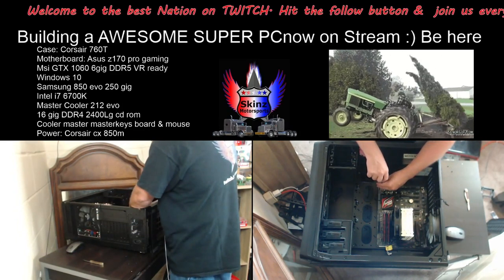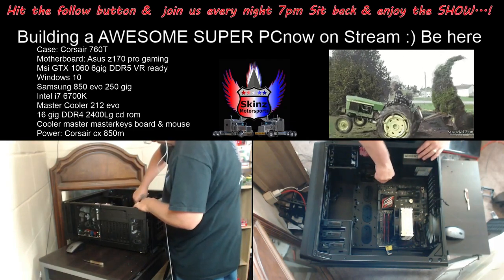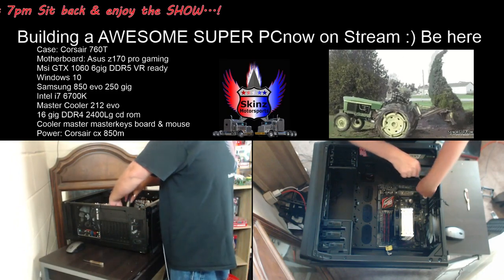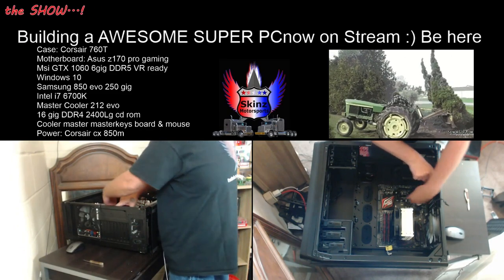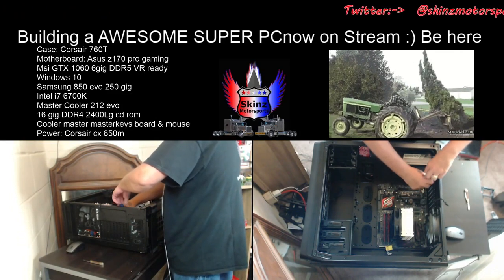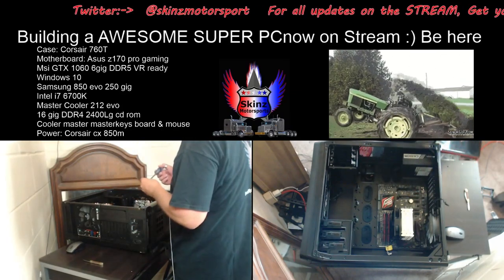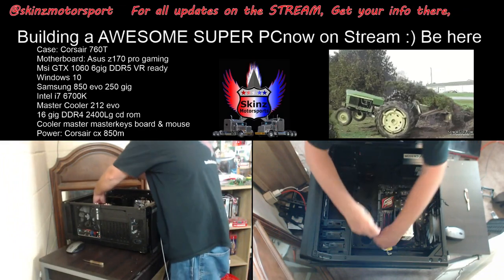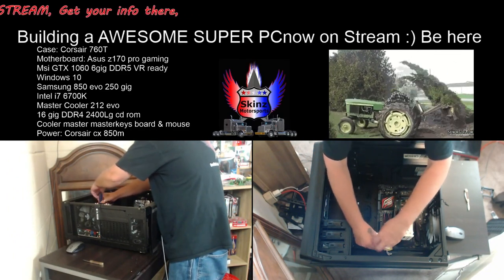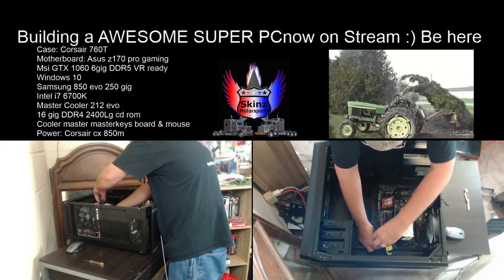Now you want to attach the motherboard to the case, making sure you get your screws nice and tight, not too tight to crack the motherboard. Make sure that you screw them in correctly so you do not strip the lower portion nut locking screw nut.